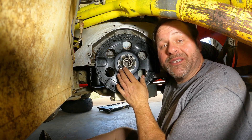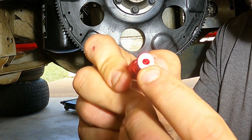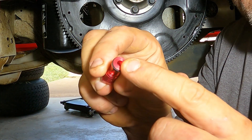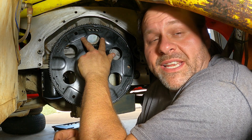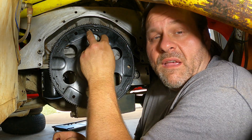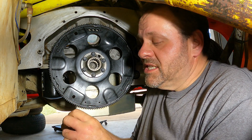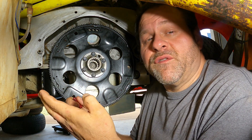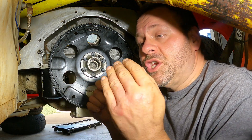We're in a tight spot here, but I want you to be able to see what's going on. These are the oil restrictors here. They have a hole right here — see the hole? — and then they have a hole drilled in the side. Oil is passing through them, so it's a metering block. What it's doing is controlling how much oil can go through a passage. The passages we're going to be restricting is where the oil is coming from the oil pump up the back of the block and where it pushes up through the galley that feeds all of the lifters. We've got solid lifters on our cam, not hydraulic, and they make a set of restrictors with a tighter orifice because a solid lifter doesn't need as much oil as a hydraulic lifter does.